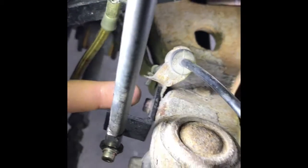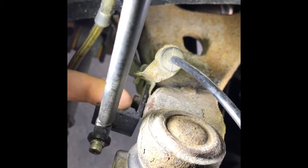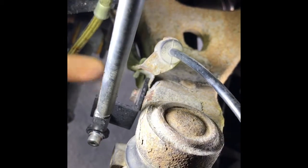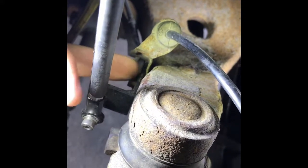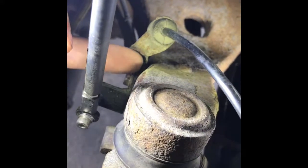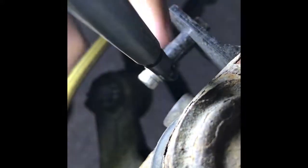The only difference with the rear is you do have to build a bracket for the bottom. This right here is a stock bolt in a stock location, and all I've done is build this bracket to attach to this point. You could also bring this bracket a little bit farther so that you don't have to end up running these spacers.